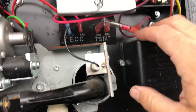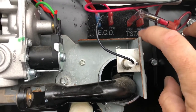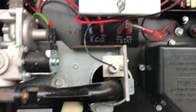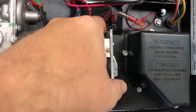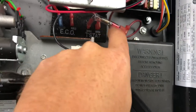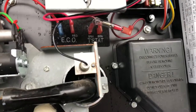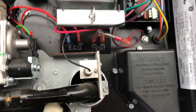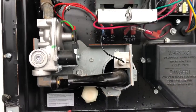Every time I see these new ones, this thermal fuse is always really low on the left side and it's not installed properly. It shouldn't be that close down into the burner tube like that. When I got here, this whole piece was bent down into it almost — so whoever installed it did not know exactly what they were doing, and it probably came like that from the OEM manufacturer.